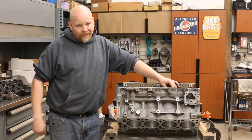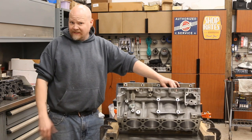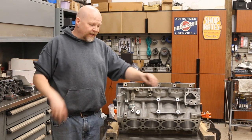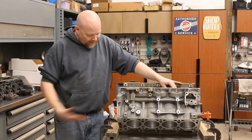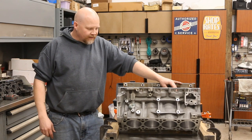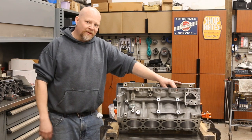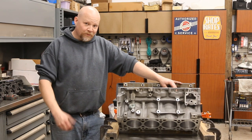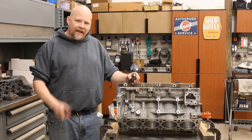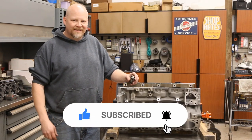And that's all there is to installing cam bearings in an LT Gen 5 engine — honestly, it's a pain in the ass. It's pretty tricky to do it the by-the-book way. Normally I would just drive all these in from one side so I don't have to deal with what we had on that last one, but some people didn't like that on my last video. We do need to check the lifter clearance for the rear bearing and we'll include an image of that. Thanks for watching, we'll see you next time — let's make magic.